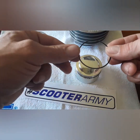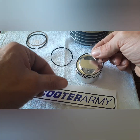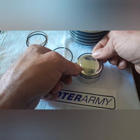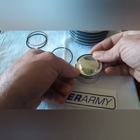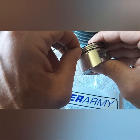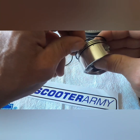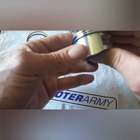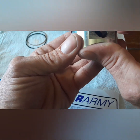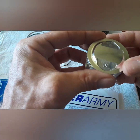We're going to line the gap up with your intake, so your ring gap is right here. Then we'll take one of the thin black ones and get the gap of that ring at nine o'clock, going right on top of that squiggly one. They're fragile but they're not gonna break — you can push pretty good on it.